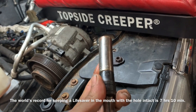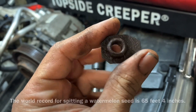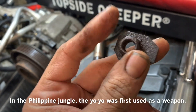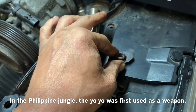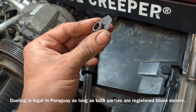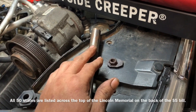In my situation, living in the rust belt, the bolts themselves were 5/8s. The only thing that fit on the nut that holds it on there was a 15 millimeter. We've got some welds in there so it doesn't go down on there super well. My other side had completely disintegrated — it was so stripped off and rusty I couldn't get it out. There's so much heat generated that the tab supposed to hold the nut from spinning has rusted off. Even needle nose vice grips don't work well because the nut is so short, and if you can get a wrench in there you can take it off, but I couldn't get one of them off.